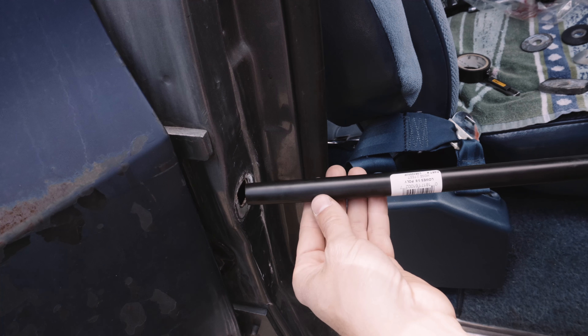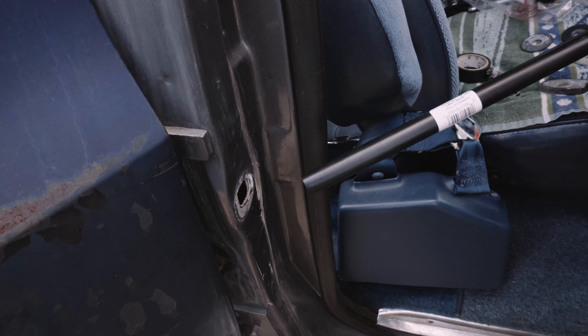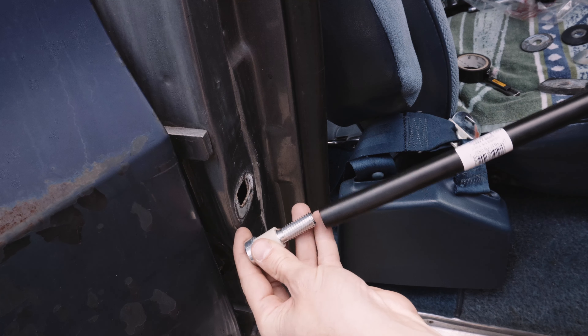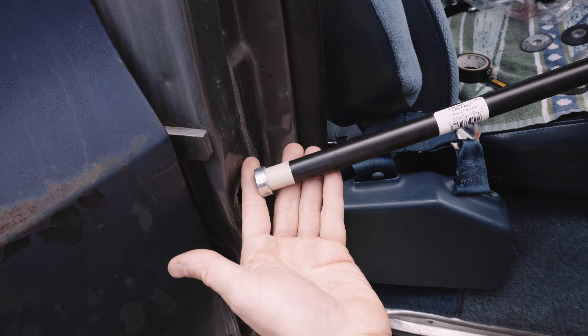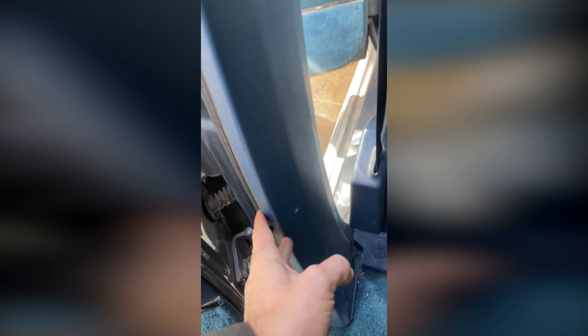The third option is one I have yet to see on the internet, and may deserve me a new subscriber from you. This option is half-inch drip irrigation tubing. This one requires removing the striker bolt, which may mean the backing nut falls down into the pillar, requiring you to remove the interior trim and use a magnet on a stick to pull it back up on a Suburban.